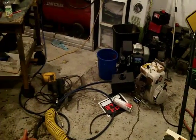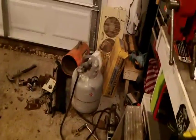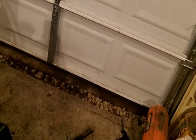As for the Craftsman that I was working on earlier, the Craftsman the second, I found a little problem with it when it was leaking. It turned out that for some reason I had missed it. I can show you on this one. I just pulled this one off the Bolens. Pretty much right along in there where the seam meets, it is split open. It's cracked. My guess is that it's been sitting for so long. Obviously water was in there when I showed you guys this morning, and it expanded and pretty much blew open the aluminum. I don't know what happened, but there's a small little crack in there, and the gas is coming up in and out the carburetor, and it's just leaking. So that carburetor is no good.